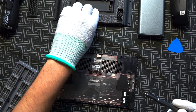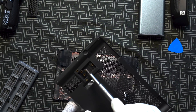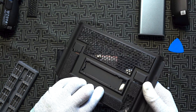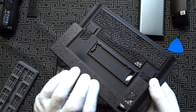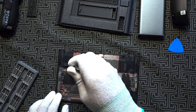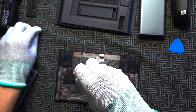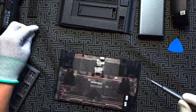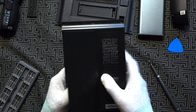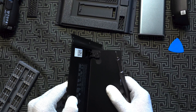In order to use the kickstand, we're going to remove the original kickstand mechanism and put it in here, since it doesn't come with this case. The kickstand isn't attached to anything, so we're going to use the original one — it doesn't come with any. Now open the kickstand and you'll see three more screws that need to be removed as well.